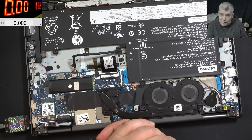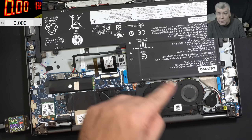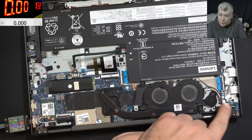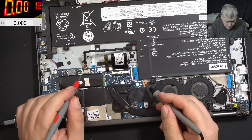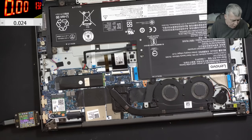We have three lithium cells - they're supposed to disconnect at 10.8 volts, so why did we have 2 volts? There's nothing I can do about the manufacturer's design. The battery is genuine. Because the EC chip was corrupted and the battery didn't disconnect the cells, the voltage dropped to 2 volts. The laptop probably isn't designed to charge a battery that low. The laptop is working fine. Let's check the battery voltage - it's 11.8V and going up, taking 1.7 amps, charging fine.